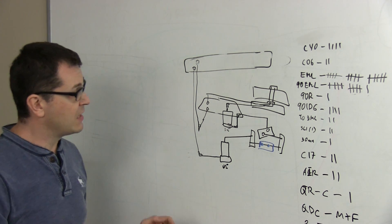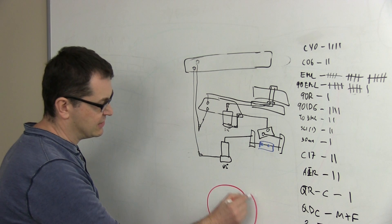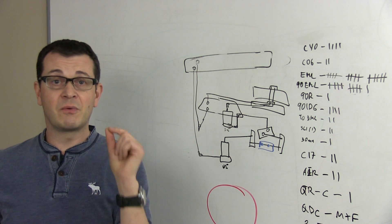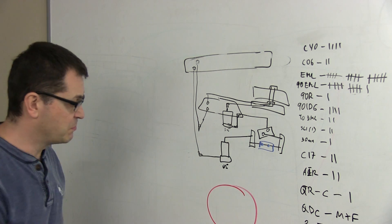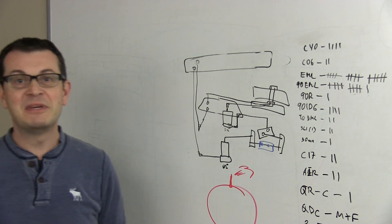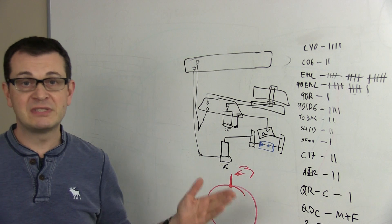One thing that gets quite often overlooked: when you connect your loop — which is really just a single loop bending many times — people often forget necessities like a drain port. You need to essentially break your loop and make a little appendix so you can drain your water when you need to change it, test things, or change the color of your liquid. Don't forget to include this type of fitting.